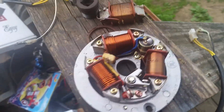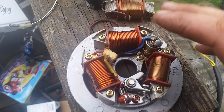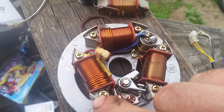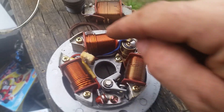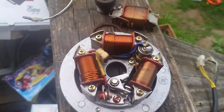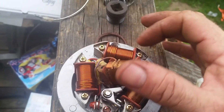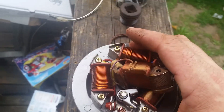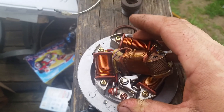This system will not work with the electronic ignition. If you have a newer one, it's not going to work — because on the CDI conversion video I did, instead of having individual coils it's all one frame, with three smaller charging coils and one ignition coil all wrapped up together. So for the ones with points ignition I can convert it; the ones without points you'd have to have the stator rewound. You can bring it to a shop that does alternators and ask them to wind it for 12 volts instead of six — it can be done but it'll be costly.